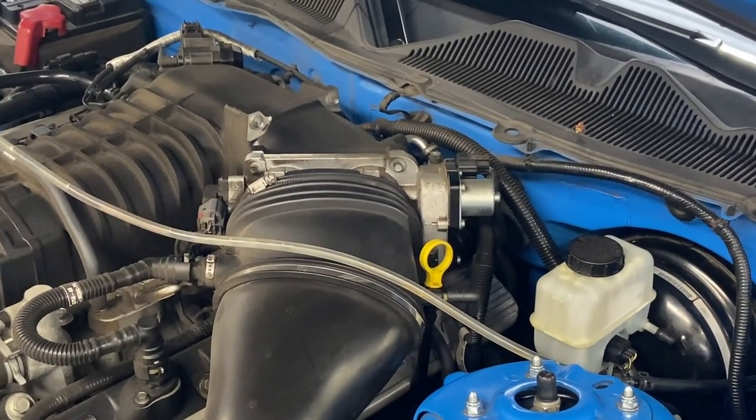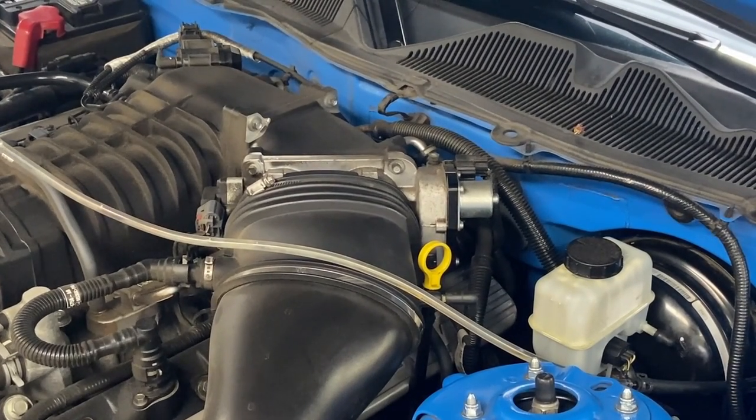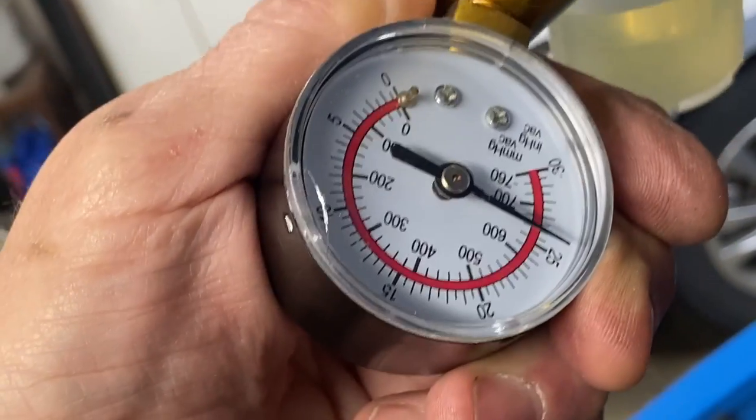And let's see if we can get some more air out. I'll go ahead and pump that. Pedal's definitely getting pretty firm now. Alright, let's see if we're still holding the vacuum here. And yeah, looks like we are. We still got some air slowly coming up here, so we'll just continue this process till we see no more air. Then we'll hook it all back up and refill the reservoir, and we should be done. We'll go ahead and take it for a test drive.